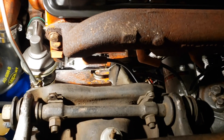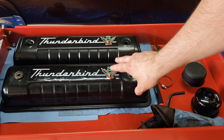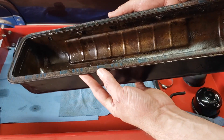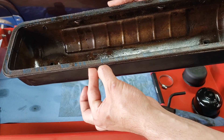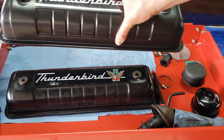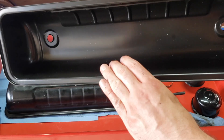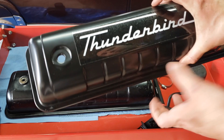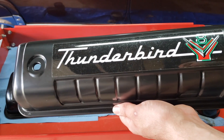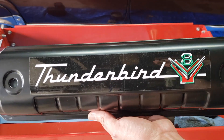The other thing on the conversion: this was actually the original valve cover on the car. I didn't want to drill a hole in my original valve cover. You can see this one has an inner lip and an outer lip. These new ones you can get off Amazon for 50 bucks as a set, but they don't have an inner lip — that's not so much of a problem because at least the oil is going to go in, but you may have some problems putting your gasket on. This one I did apply the new sticker to. My only recommendation is make sure you clear coat them before you put them on the car — they scratch a little easy, so if you clear coat it first you can avoid some scratches.